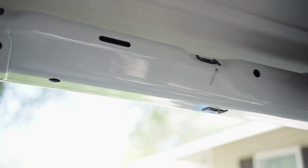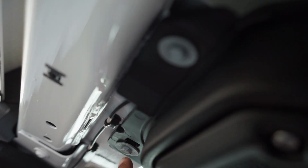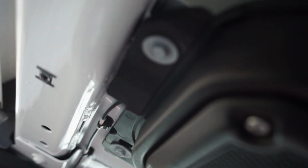You have to take those out, and then you can just pull these out. They are held on with some metal retainer clips, or regular, whatever kind of clips they are. If you see, I've already done the driver's side. See, you just pull those off. It has the clip, and then you can get to the 2 bolts right here that secure the soundbar on, and it'll be on that side, and then you'll have them over there, and then the soundbar can drop down.